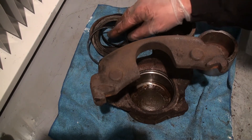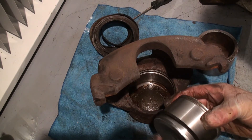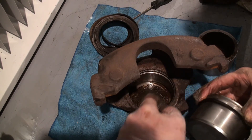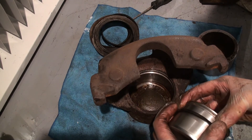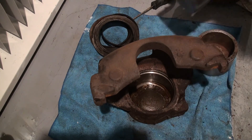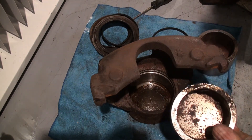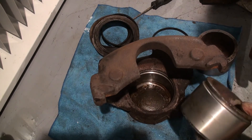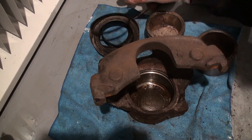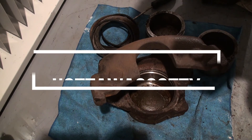I think why I didn't understand how these were freezing is because I was thinking the piston rested against the seal and not against the edge of the bore. But now that I can see how much contact there is between the bore and the piston, I understand — it's very similar to the clearance between a piston and bore in an engine block. Anyway, I thought that was eye-opening, and I hope it was helpful. Auto Scotty signing out — see you next time.